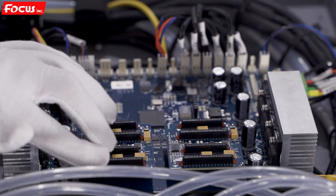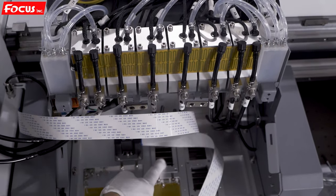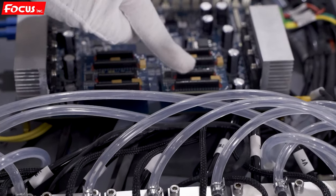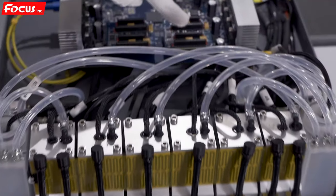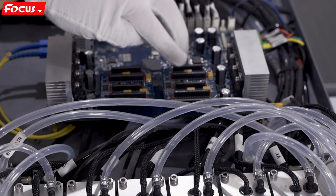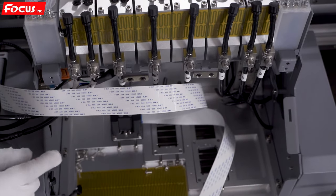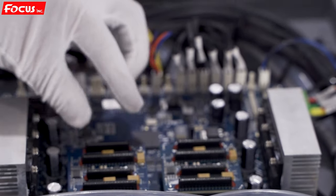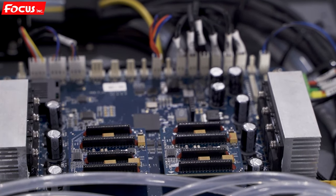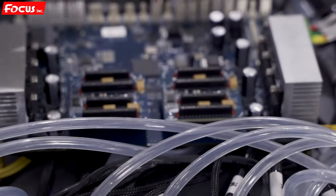At the left bottom, these two ports are for connecting the color print head. At the back side, these ports are for that print head. On the right side of the carriage board, these two cables are to connect with the first print head — white color varnish. The white print head connects to the bottom two cables on the right, and the top two cables on the right are for connecting to the varnish print head. Each port has one short and one bigger plug, and the cable from the print head also has a small and a bigger port — connect by matching small to small and bigger to bigger.